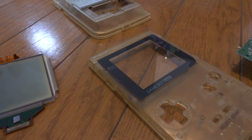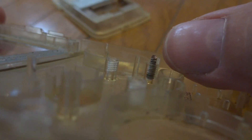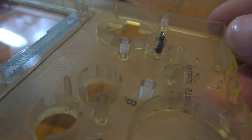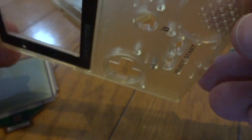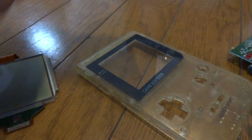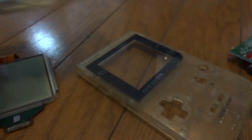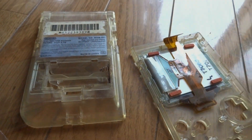We're going to have to clean up the contact points on that side as well. The casing seems to be decent, although there is that one screw which got wedged into a spot where it shouldn't be — you can see the screw holes here, these ones are supposed to be where the screws go, but this one was just forced in there and eventually it looks like it ripped off or rusted off. We'll try and scrub this out, remove that screw, and then go about fixing the rest of this casing and getting these tabs out and some new ones in.